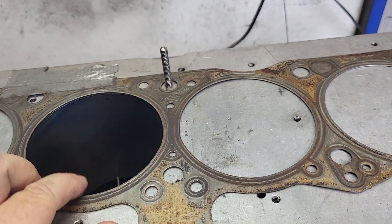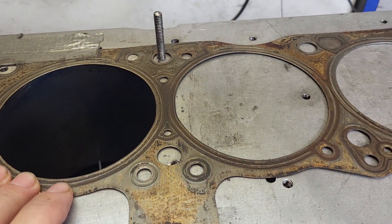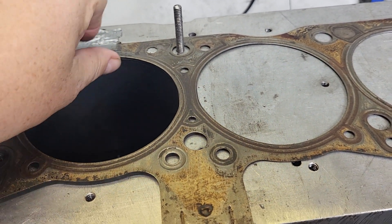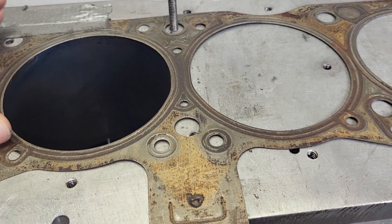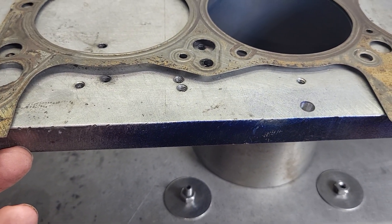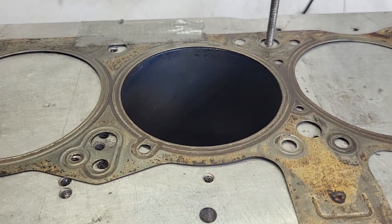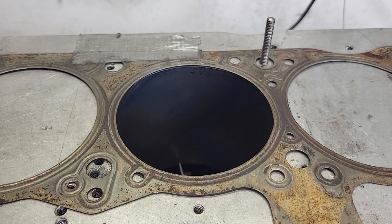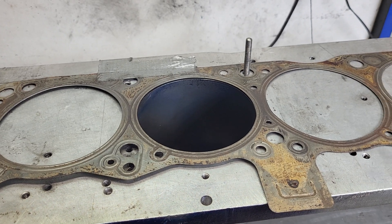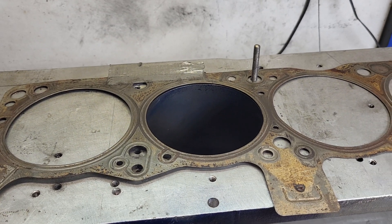The quick and easy way to center a head on the bore adapter is to lay the head gasket out, make sure it has the proper amount of overhang on every side, and put some duct tape to hold it in place. You can use the edge of the head gasket to line up on the edge of the head in both directions, because if it's off a little bit it will change the amount of flow you get through it. This bore adapter actually isn't big enough to do big block Chevys without shifting the head because the valves will actually hit, so that's a little problematic.